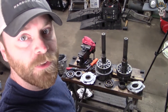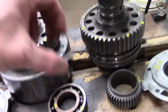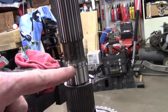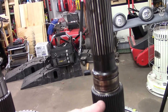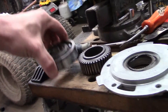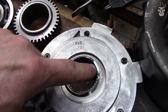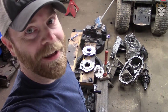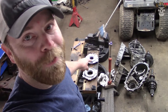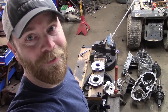With the 246 and the 261 torn apart, there are unfortunately a lot of differences between the two. The snap ring from the 261 goes here but on the 246 shaft it'll slide right past - the machined surface is a lot narrower. The gears are different heights, the speed sensor is different, the bearings are different heights, and unfortunately the pump opening for the 261 is different than the 246 so I won't be able to use this pump. I'm not going to give up being this far into it though. I've got a T15 Torx right here - I'm going to try and pull these pumps apart and see if I can use the housing from the 246 combined with parts from the 261 to make something work.